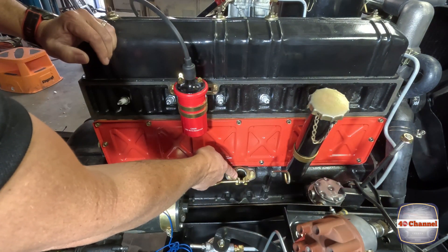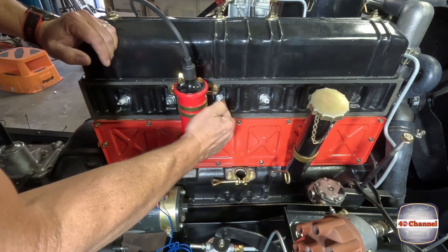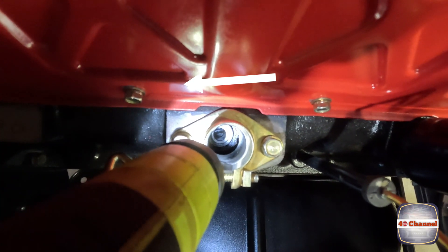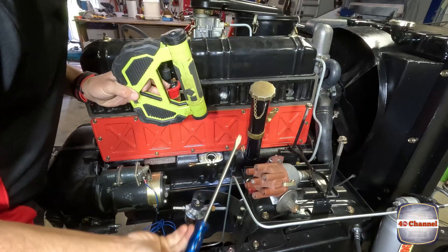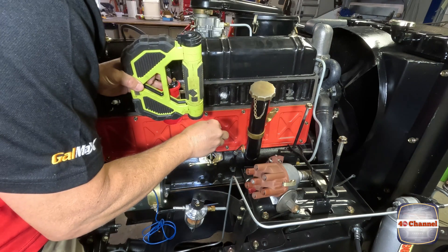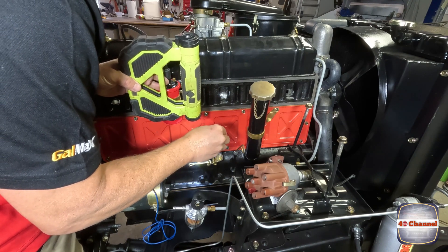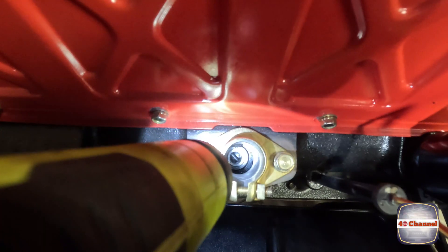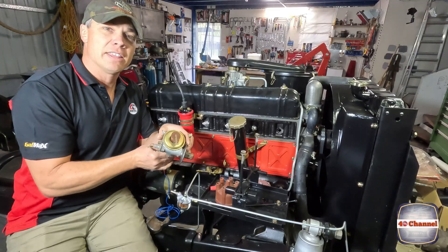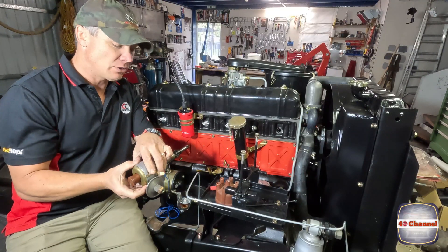We'll get a big screwdriver and rotate - the oil pump is just past number four here. You can see where our slot is right now. We're going to put that screwdriver in and spin that oil pump around. Slide the screwdriver in - we want to turn it, pointing just past number four. Hopefully you can see that's the position we want to be in. There's our rotor - we can spin our rotor nice and freely, which is important. That's where we need to line things up.